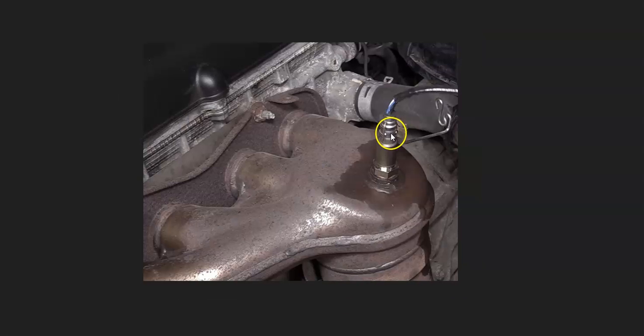Also keep in mind that these sensors are on a fuse, usually located inside the engine compartment. For example, here on a 2005 Toyota Tacoma it's labeled 'AF heater' — that's the fuse for the O2 sensors. There can also be a relay; here's an AF heater relay that would be for the oxygen sensors.